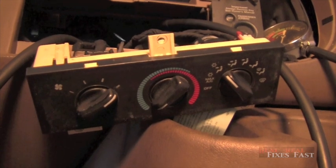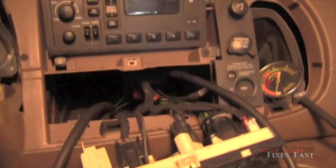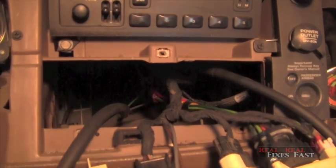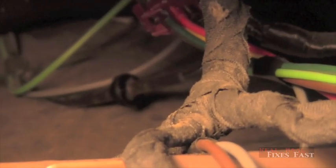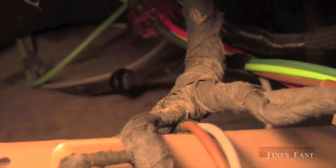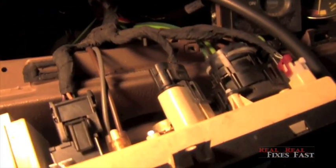So what we're going to first do is go inside here. I've got it lit up where we can take the camera and show you what we're going to do. This is your heat selector control module, and it's vacuum-operated. It comes out of the dashboard right here. In order to gain access to this one, we have to kind of take it out so we can reach down inside there. You can see the check valve down inside there — located right there. That check valve is a one-way valve, plugged into the feed line which is drawing vacuum from the intake. It comes up here, travels up to this color line, and goes in the back of the module.